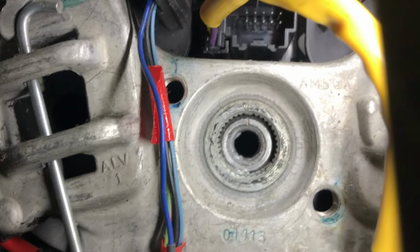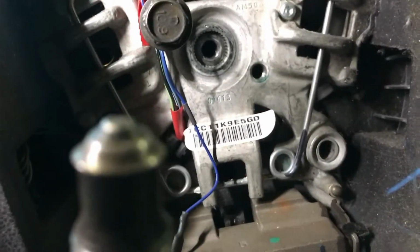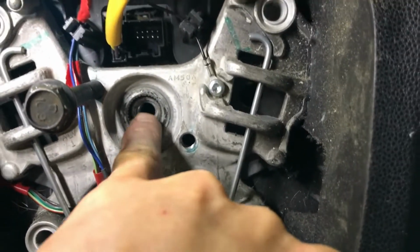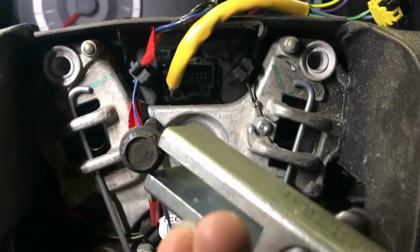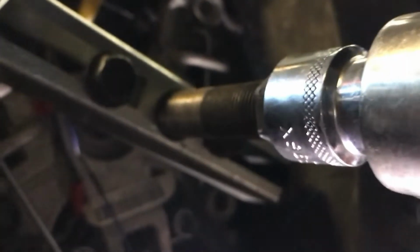And the steering wheel has a master spline and a cut on the shaft. And these are the two kinds of tools used to remove steering wheels. You just have to find the one whose bolt head will fit through the steering wheel to the shaft, but make sure not to damage the thread, and find the right bolt that screws into the steering wheel.